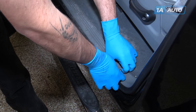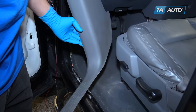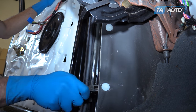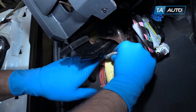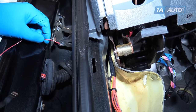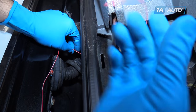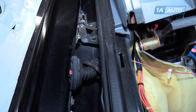Lift up on the seam of the kick panel, lift up, and pull the panel out. Just below the parking brake pedal is a weather shield. You'll have to pop that out of the way with a pair of needle-nose pliers behind the plastic clips — just pry them out. Fold it back until you can see where the door harness comes through. Feed the wire one at a time between the retainer and the actual wiring clips. Find that wire when it comes through on the other side and pull it through, careful not to make too sharp an angle or chafe it against any other metals. Once that's through, start the other wire the same way.